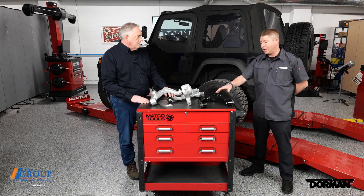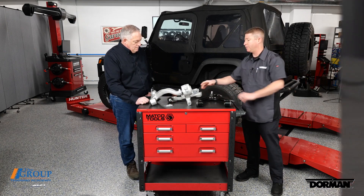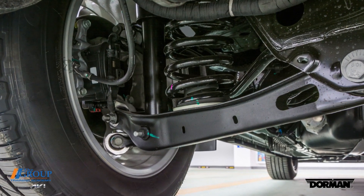The components have obviously become more of a loaded or complete assembly over the years. To start with, they were heavy — often made of forged or cast steel. As suspension technology evolved, you move to lighter components like stamped steel, which lightens the weight. As technology increases even further, you get to lighter-weight aluminums, and on late-model vehicles you have reinforced plastics.